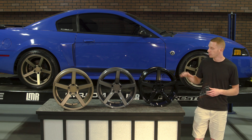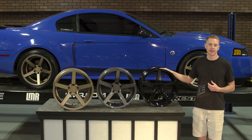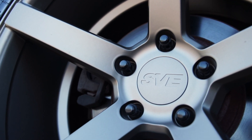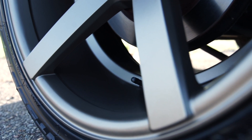As far as fitment is concerned, this NVX wheel will fit all 1994 to 2004 Mustangs, except those running aftermarket big brake kits, including the Cobra R style kit from Ford Performance. These will also not fit the 1999 to 2004 Cobra IRS, as the length of the axle shaft will cause the center cap to not properly install into the wheel.